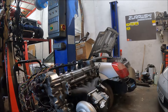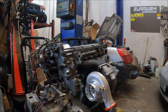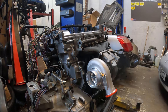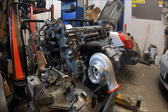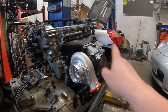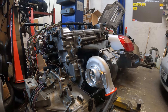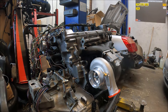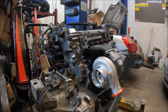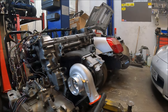If you're on relatively low boost, chances are it will peak as high as it would naturally aspirated — if not higher. That's the thing when you've got a nice healthy turbo with very little back pressure, close to one-to-one or less — you end up with a really high peak power level. My 180 for example: factory peak power with the NA cams I've got is barely over 6,000 RPM, but mine with a big turbo and very low back pressure peaks over 7,500 RPM with those same little cams. Same on my old RB20 — I had a Compressor Racing RS341, which is effectively a HY35 with a 9cm housing. It was single scroll, pulled hard, made peak power nearly at 7,000 and pulled hard without any let-off to 8,000 RPM on a stock head and stock cams RB20. You'd never have that from a normal RB20 because it's choked up.